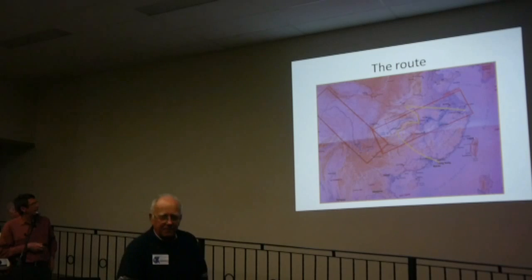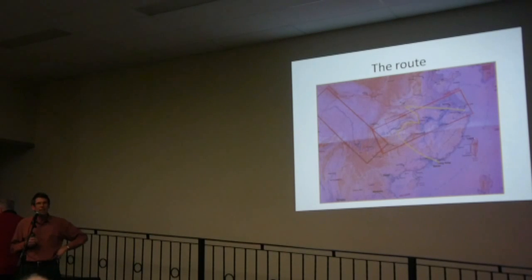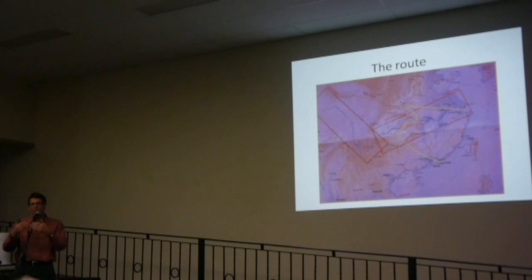While I was getting this tour together, I was also having a bit of an issue with the motor in my electric car, which has a regeneration capability because it's an AC motor. When you apply the foot brake, the regeneration occurs over a very short space of time, about a second or so, and it's really not optimum. It's a bit of a jerky effect in that it pulls the car up and you get current flowing back into the battery as you're supposed to, so you are getting the effect.